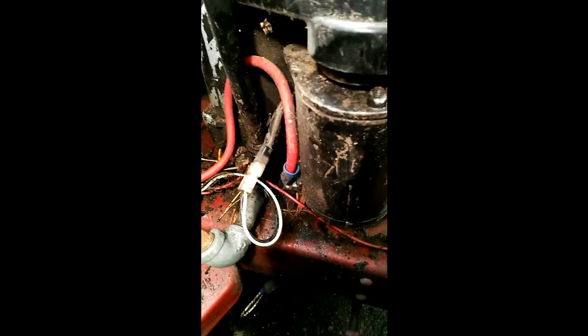So I started checking out the wiring. I decided to start at the starter. Don't know why, just plopped my bucket down here, that's where I sat. Checked out the connections, looking for corrosion, obvious splits, and nothing looks too bad. Also, there's a fuse in there that actually turns out is for the light circuit. It was fine too. I checked the obvious stuff first.